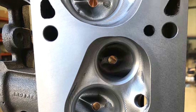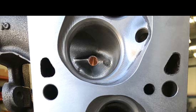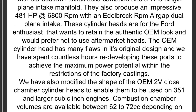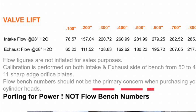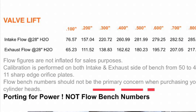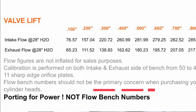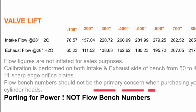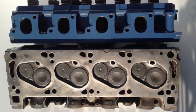That goes to show why these Clevelands were the kings of the 70s, 80s and 90s, both in 2V and 4V configuration. This is a badass set of 2V iron OEM heads, all CNC ported — it doesn't get better than that. They retail for around $2,700 Australian, which is about $1,800 US, and that's all complete — CNC ported, machined, Isky 8005 springs, stainless steel single groove valves, 10-degree locks, retainers, and all that. Every head has a limit, and flow CFM isn't everything.